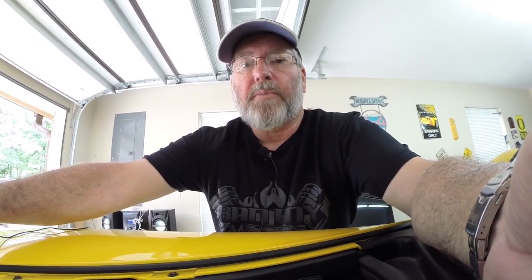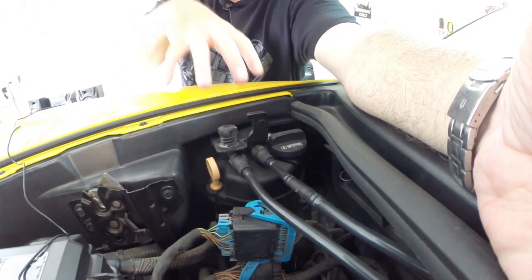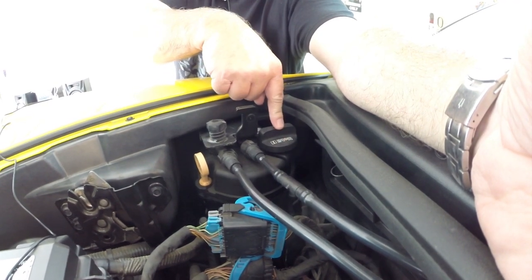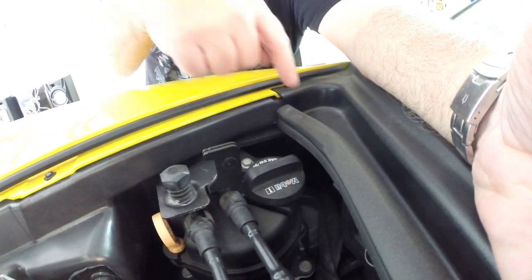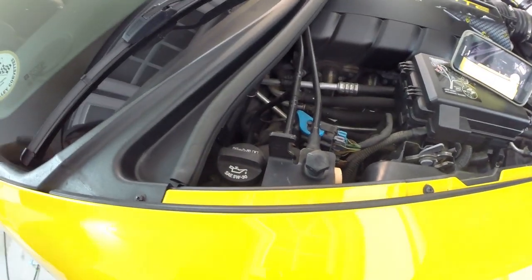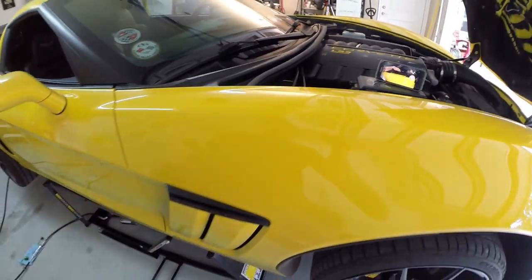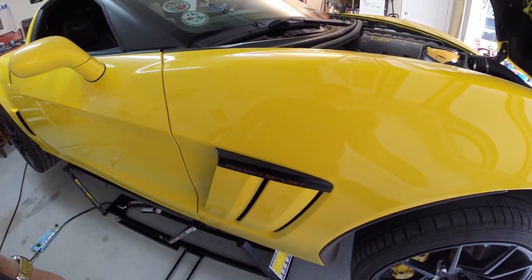Here we are on the top side of the engine. The most important thing to notice about a dry sump system is this is where you check your oil — we're on the passenger side of the car. This is your dipstick for checking your oil, and this is your oil fill on this side of the tank. You can see how the tank is down here below and it drops down further behind the front wheel. We've already got it up on the quick jack to make the oil change easier.